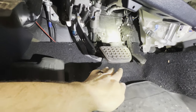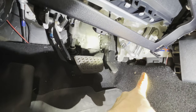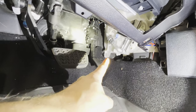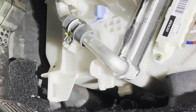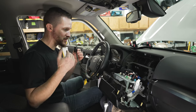Routing our camera wire from the dash is really simple. I went in from here, underneath the carpet, down under there, around here. I had to remove the kick panel, which just pops right out, and then up to the switch location. The only note is you want to make sure your wire does not touch that metal pipe, because that is part of your heat system and can get really hot.